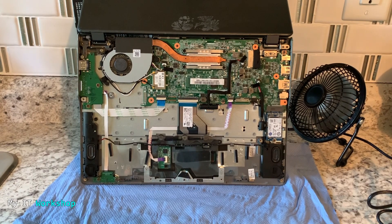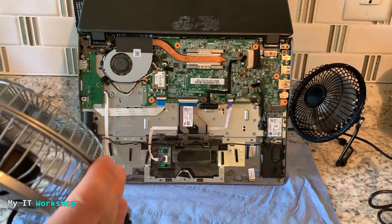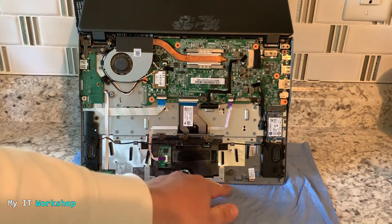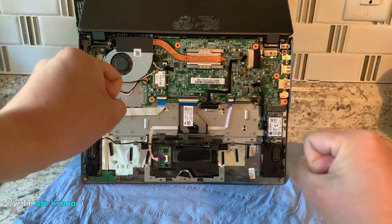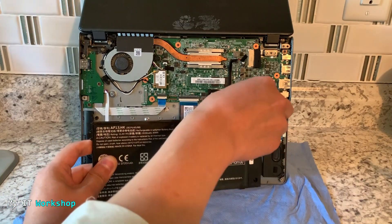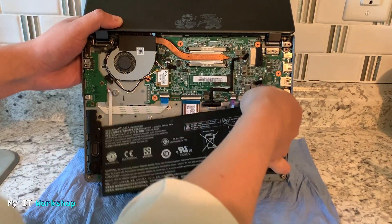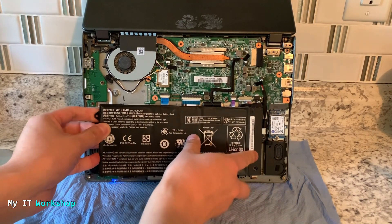Welcome back — I left it drying for around three days, and as you can see the fans are still working. Now I'm going to turn them off and see if it's working. As you can see it's dry over here, no more water. I'm showing you I'm not wearing any watches or jewelry. Now I'm going to connect the battery back to the motherboard — after a few tries I was able to do it, and you can see the light is on. That's a good sign.